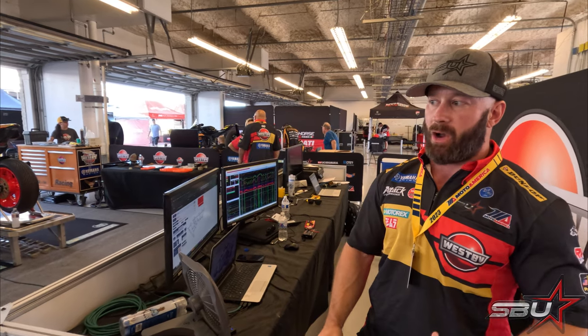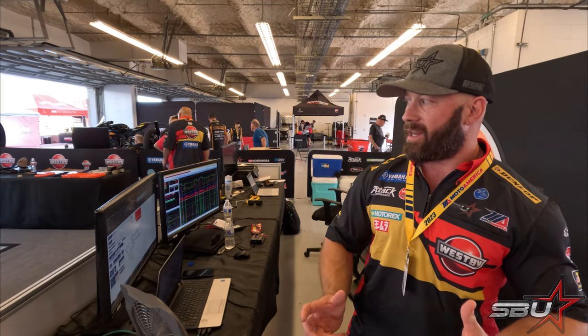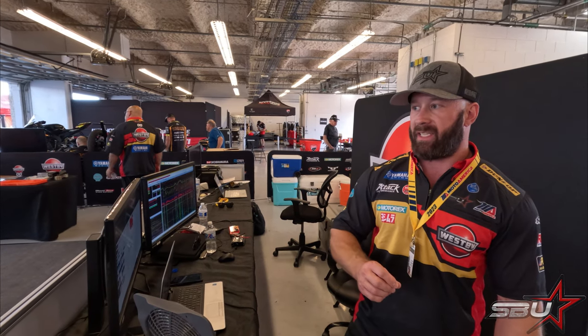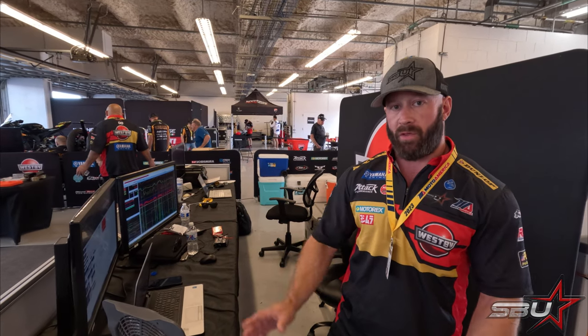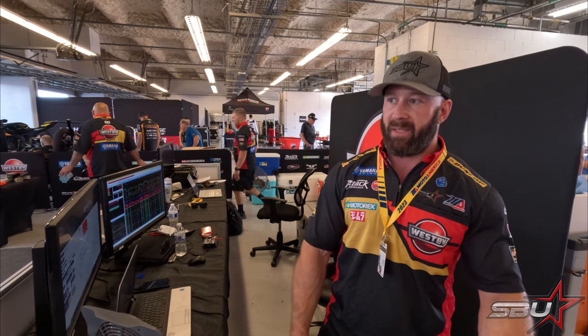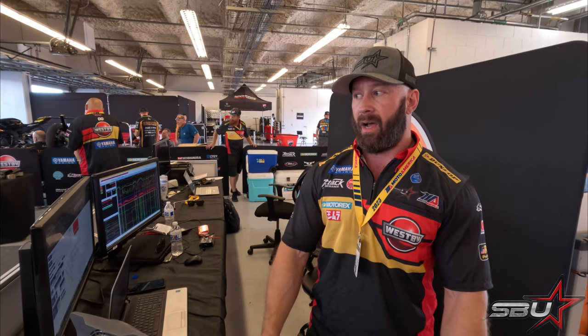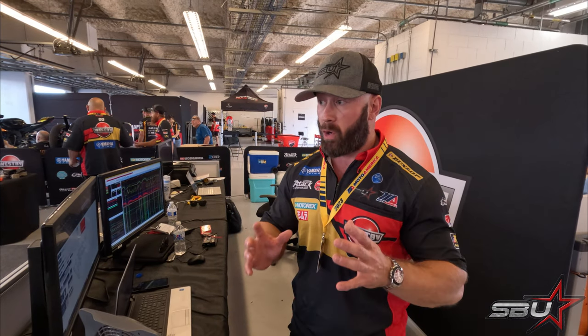All of our settings are going to be loosely based on last year, but a lot of that isn't going to translate because for the 2023 season, we've got a major firmware update with our Marelli ECU. With that update came a whole bunch of new strategies, and a lot of things didn't really transition from last year's firmware to this year. It's been challenging for me from track to track because I've had to build everything back up. It's been a good opportunity because it's forced me to learn a lot of the ins and outs of this firmware.